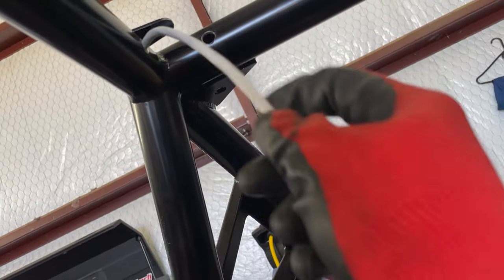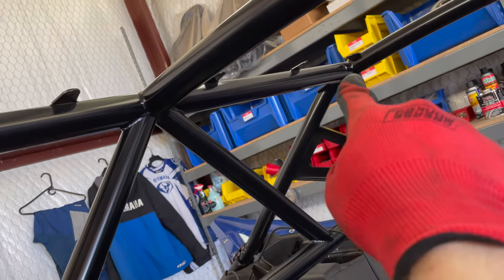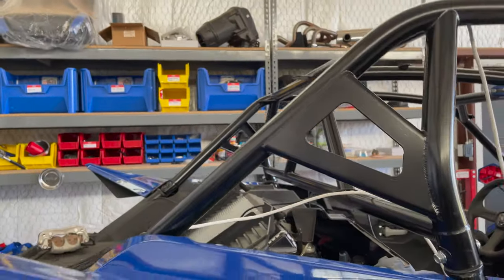And then, this one that I just did is for the whips. So like I said, this is a four conductor wire. So what I'm gonna do is strip it back and pull two conductors out right here that connect to this whip. And then I'm gonna take another two conductors, cut them real long, like another 6 feet or so, put them in this pipe, and then push them all the way down there and pull out over there. So for that second whip, all the wire is running in the tubes.